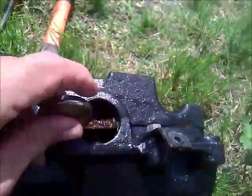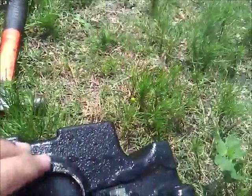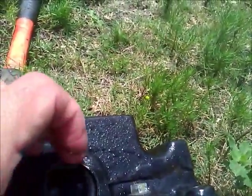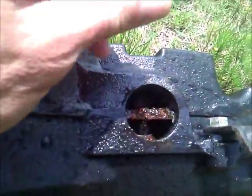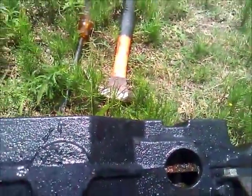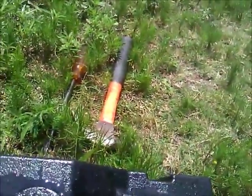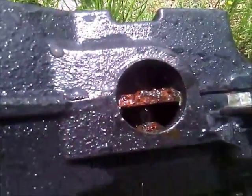The other thing that happened was this freeze plug was all the way down in there and had plugged these two passages, so it couldn't go from this passage to that passage. I'm not sure how the water gets from A to B, but I wanted to show you that. This is a brand new manifold and water won't go through there, so we'll see if we can get it unplugged — otherwise I'm gonna send it back to the manufacturer.